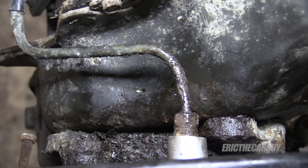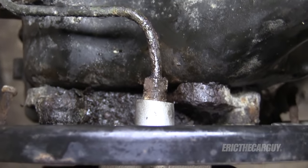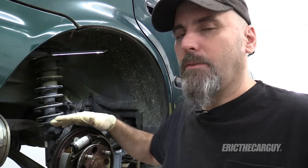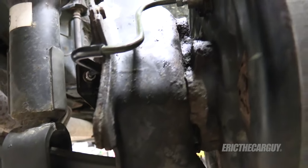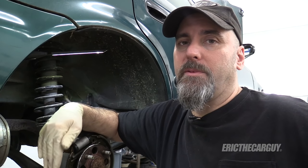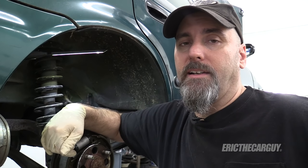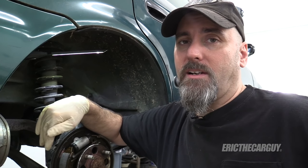And there you go — no damage to the brake line. Despite how rusty and crusty it is, I saved myself the time and expense of having to replace it. One last thing viewers: I ended up replacing this rusty brake line. The reason is I went to do that final tighten and it created a very small leak. Any leaks in the hydraulic system of the brakes is unacceptable, so it needs to be addressed. I addressed it by replacing this brake line. If you have a very rusty brake line, it's only a matter of time before it rusts through completely, so you should take the opportunity to replace it as soon as possible.